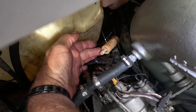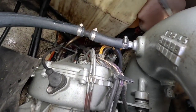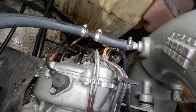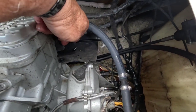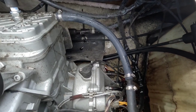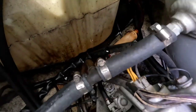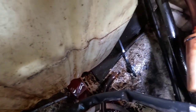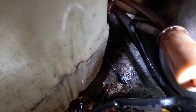On the bottom I unhooked the oil going to the engine, where the filter is. Then the last thing that's hard to get to — I pulled the hose off the top, because that hose on top of the tank goes down to the bottom side of the motor underneath the injectors and cylinders, and that goes down to the shaft for the rotary valve. The last line to unhook is the big line on the bottom that also feeds the rotary shaft, and then I'll get the tank pulled out.